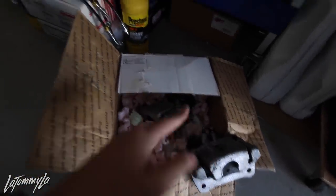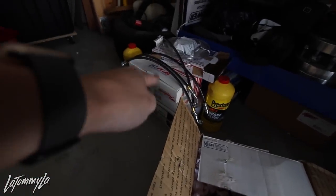I picked up, well, this is not from Honda. Oh, super bright, bro. This is from Home Depot, just to bleed the brakes on the rears. And in the front, I have extra tubing over there because I am bleeding brakes by myself. And I picked up the caliper brackets for the e-brake cable. So thank you to one of you guys that told me that I was missing the bracket. I picked it up. So now I just have to install all of this.